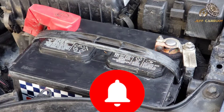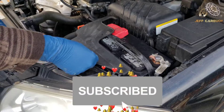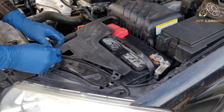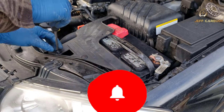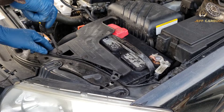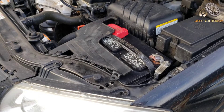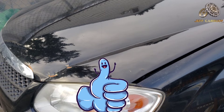Always start with the positive side and then tighten the negative last. And this is about it — that's how you clean and protect your battery terminals from corrosion using this simple method with baking soda and water. Easy and cheap — I spent less than ten dollars to do the whole job. If I took this to a mechanic, they'd probably charge me maybe fifty dollars or so. Thank you guys for watching, stay tuned, more videos are coming up soon.